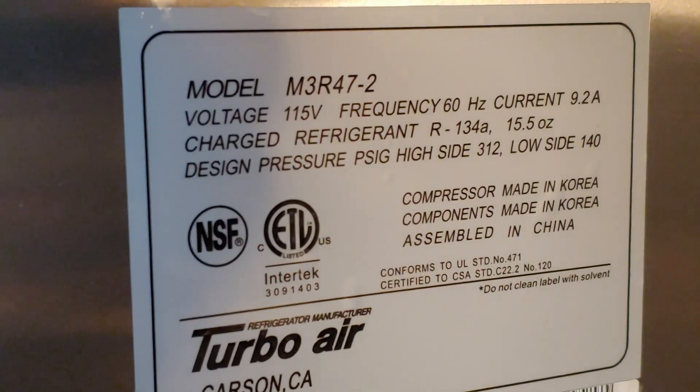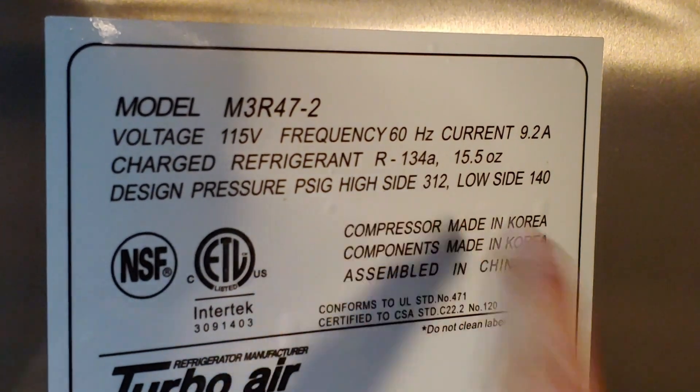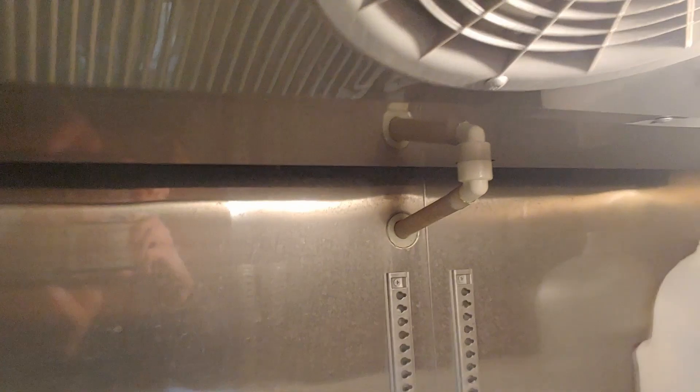You'll want to find your tag — that will tell you what kind of refrigerant and how much is in the unit. You can see we've got 15.5 ounces of R134A. The other thing you want to check is make sure that the fans are working. That fan is working and I already confirmed the other fan over there is also working. Also make sure there's no ice or dirt build-up in the coil, because if you have improper airflow through the coil — bad fans or a plugged coil — the coil will freeze up and the system won't cool.